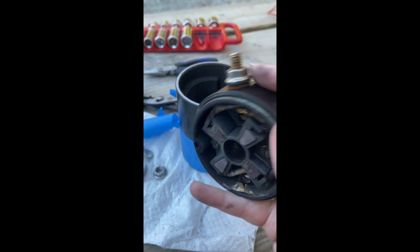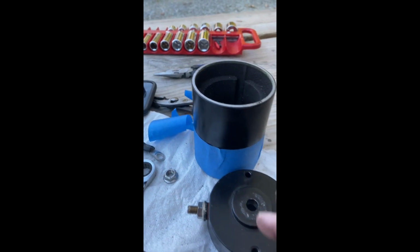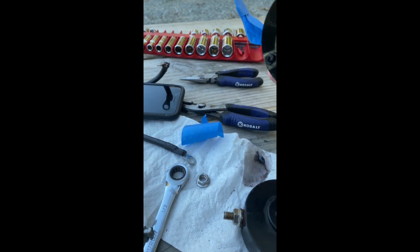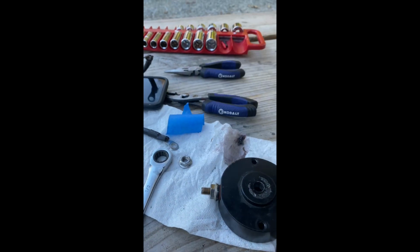So luckily we have a new motor coming tomorrow, and we should be able to put it in. We are not having to bleed any of the hydraulics in the meantime, which is really nice. And in theory, we should be able to just take the new motor, make sure it's all greased up and the seals are where they need to be, and replace it.